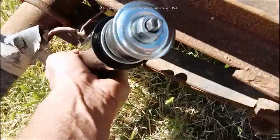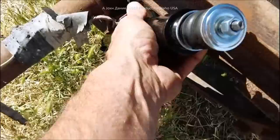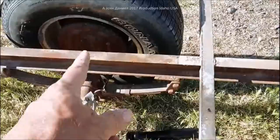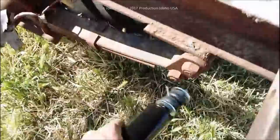We're going to show you how to make a little box in here for the shock to mount on, so it will literally sit at about that angle up inside the frame, about an inch off the frame itself. In the area where the perches are, we're going to box it on both sides to strengthen it up, add cross members, and put some pieces of plate down on both sides of the cross member so it gets very rigid.